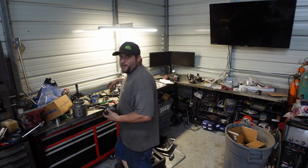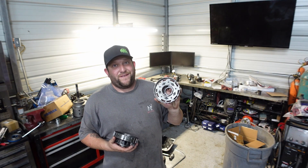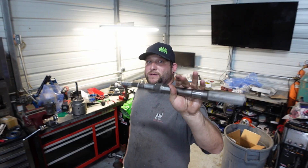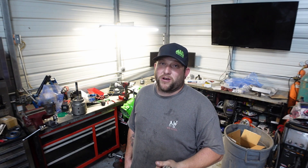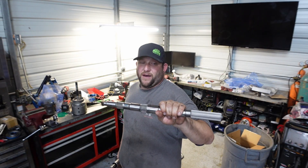Remember, time is money. Another big upgrade we're doing is four-pin to five-pin planetaries. These are great. You can get Sonix aftermarket planetaries, but we're using GM. I really like the GM stuff — it's a little bit less expensive than the Sonix, but it works just as good. Next thing we're also doing to this transmission is replacing the stock output shaft with the Sonix heavy-duty output shaft. I've seen a lot of people with sticky tires trying to leave with the stall converter and shatter output shafts. That'll cause a lot of damage as well.